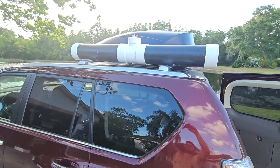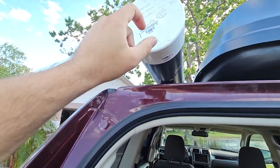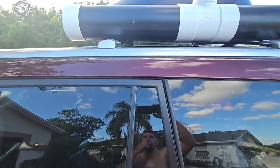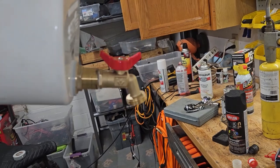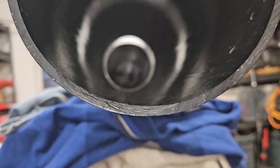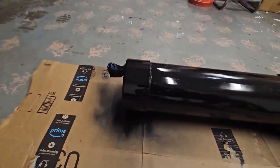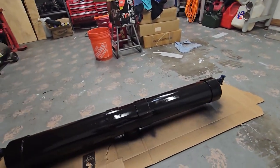I'll show you what it looks like on the truck. There it is on the truck - obviously I need to paint the back here. It's just going to be a little spigot, and I'll put a link for that in the description. Just drill a hole - it comes with two O-ring flat O-ring type seals, and it's just going to get secured down to the roof cross members with some big zip ties. You want to mount your spigot as low as you can on the pipe to get the most water out of it, but if you put it down that low you won't be able to get the pipe to sit all the way in there unless you bevel it. So I beveled the bottom part so it'll fit all the way in there - this is paper thin at the edge. That way I can get it as low as I can to get the most water out of it. Pro tip - thought that was kind of clever. I've got spigots on both ends for redundancy, and if the vehicle leans real bad you could swap the hose to either side to get a little more water out of your system.